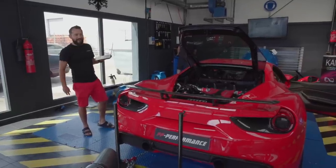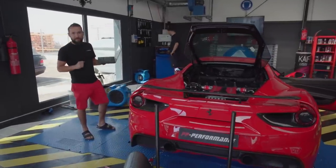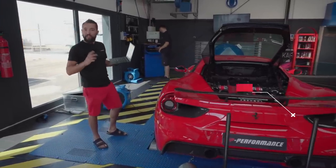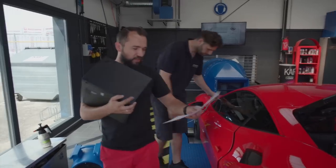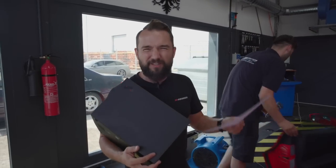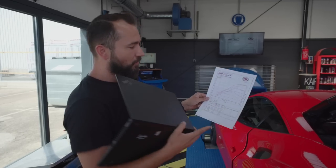Mode 2 measured. Compared to the previous run where we had 790 PS: I added 3 degrees of advance and leaned it out to 0.78 lambda instead of 0.76. That brought nearly 30 PS — actually 32 PS. We now have a power output of 822 PS and 960 Newtonmeter torque. Comparing to the baseline: roughly 630 PS in, now 822 — that means almost 200 PS more. Torque went from 730 to 960 — that's 230 Newtonmeter. 200 PS and 230 Newtonmeter more across the entire rev range.